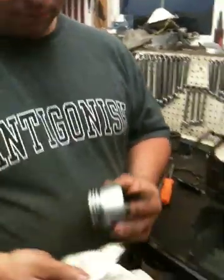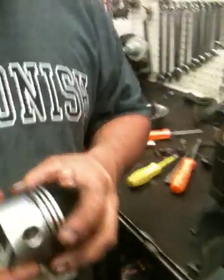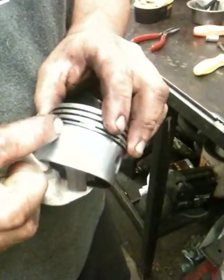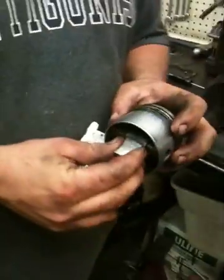Normally, what would they be? Down? They're different on every piston. Every piston's different. Sometimes you can make out, if you look inside the piston groove, you can see that recession there that's supposed to sit into. Sometimes you can figure it out that way, but best thing is having a shop manual. And you can probably find anything you want on Briggs and Stratton online. You'd figure that out somewhere, somehow. A shop or something will give you the information.